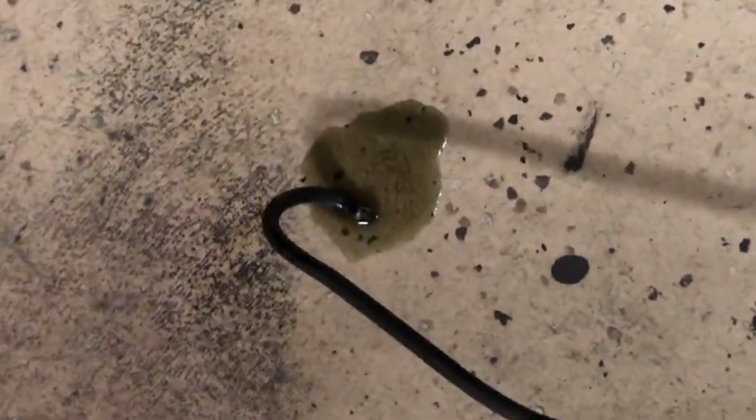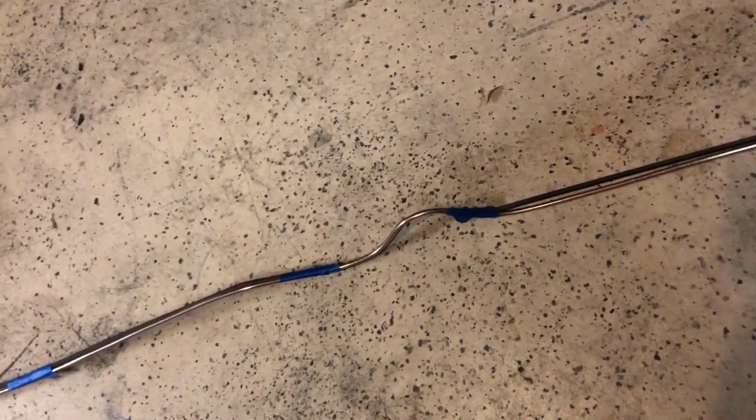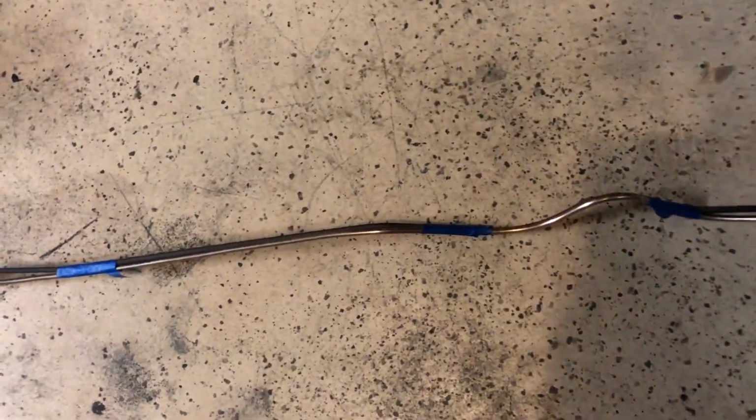Here's the rear brake line. It's actually quite easy to take it out under the frame rail and down and over and around the parking brake. And then would you look at this? As I was removing it from the proportioning valve, it likes to do this with old brake lines. They seize up and then they twist and split. And so that's a broken head also. Really wonderful timing. I was halfway through unrolling and making my bends with my little tool here. It's just such a useful little tool. Thankfully, they use copper, and copper's very forgiving.